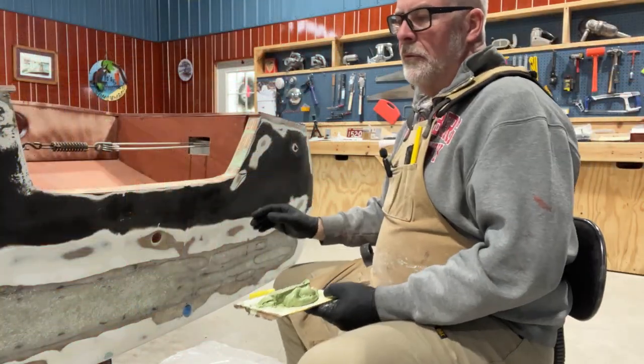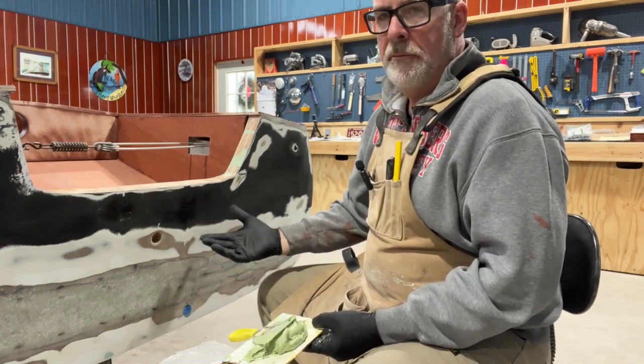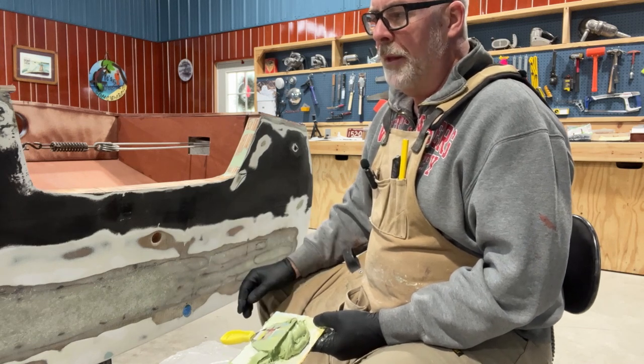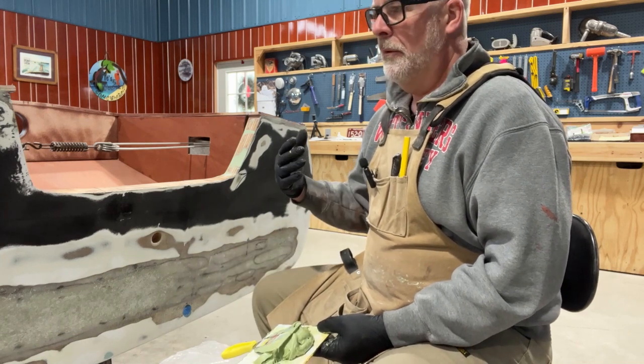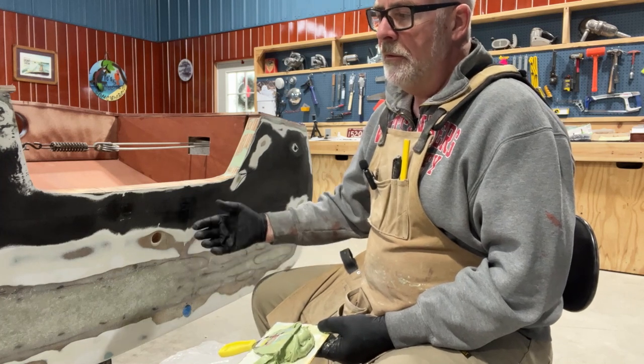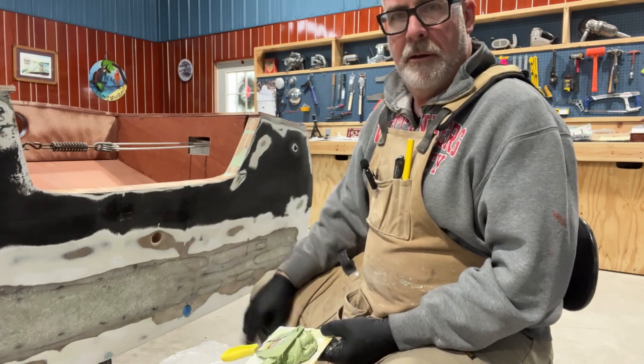I've also been traveling, so this video comes a little later than our once-a-week episodes. I know I've gone to two and we'll be going to three-week gaps until I'm done traveling. So let's get to work. I've got the surface cleaned, both with a vacuum and then I went ahead with the echo solvent, which is made by Total Boat. It's kind of like an acetone alternative — they both smell bad, I wear a mask for both. It's a good cleaning agent; it does the surface prep you need in addition to sanding and it'll give you a guaranteed clean surface for connection.